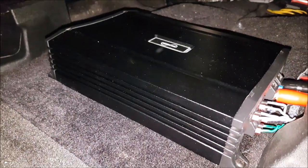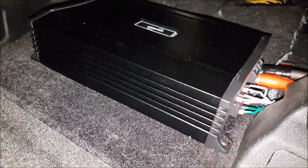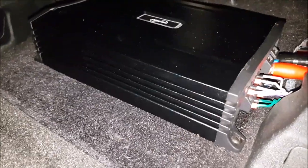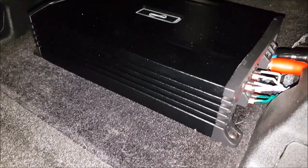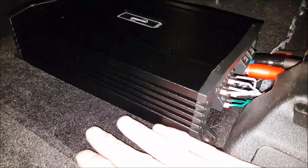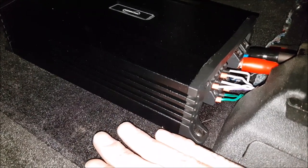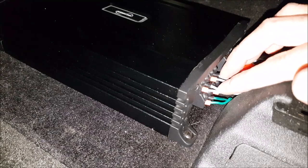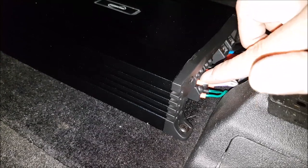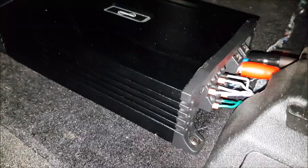Here's where we elected to put our soundstage amplifier — we have a composite substrate underneath the floor so we're not punching through the aluminum. Install standards have gone so much higher now, so composite substrate, not wood if we can help it, because wood can pull moisture. Plywood is better than MDF; I never like to see MDF underneath the carpet. You can see we have ferrules on all the wire connections, because when you have an amplifier with set screws, the set screws can dig into the wire and cut it. Ferrules give a much nicer-looking and more durable install.